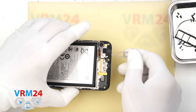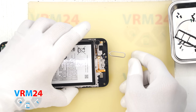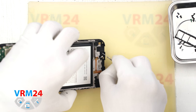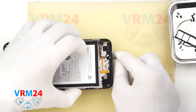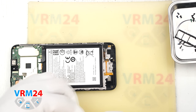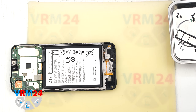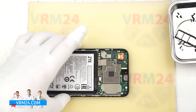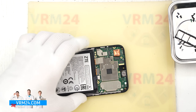Here is a quick note about the microphone opening: the microphone hole is L-shaped in the display frame, and the actual microphone is on the subboard on the reverse side. If we insert something into the hole, we won't damage the mic itself, but liquid could easily get through.